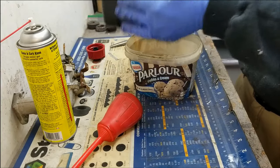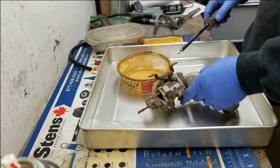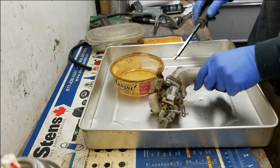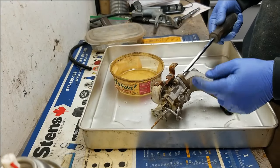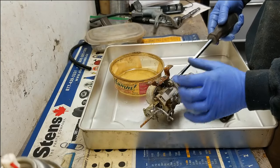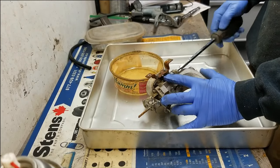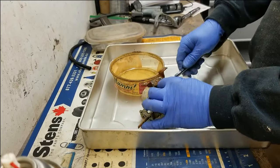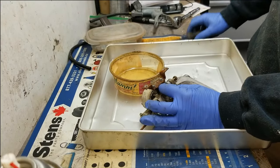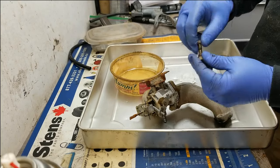I'll come back when I start breaking down the carburetor. Up on the bench now, I'm going to split the intake from the carb. There's usually a gasket similar to this one in between those two pieces, so try to do it carefully without busting up that gasket. The intake bolts are seven-sixteenths, but a lot of times you can just spin them loose with a Phillips screwdriver without even grabbing a wrench. Yours might be a three-eighths bolt with a seven-sixteenths nut; this one just happens to be a Phillips head screw.